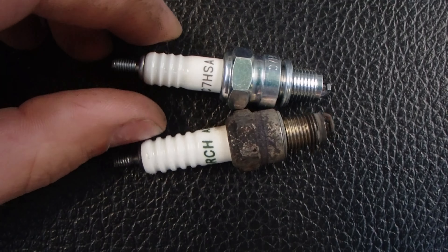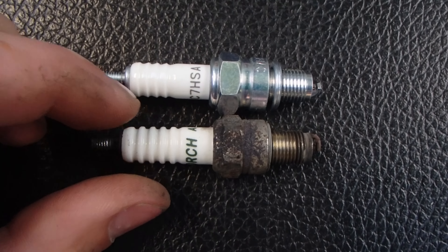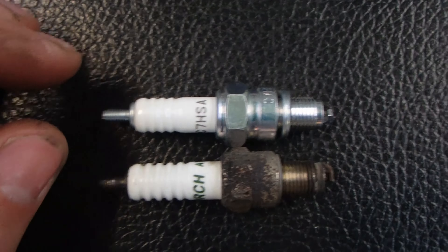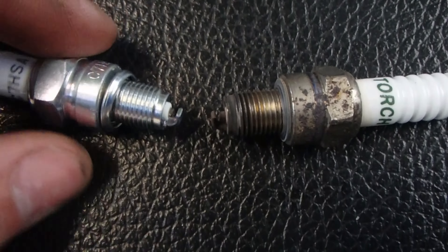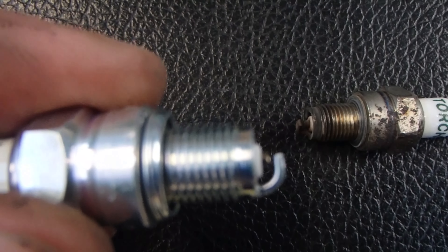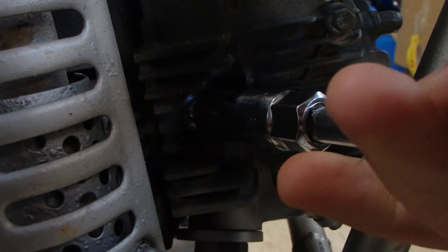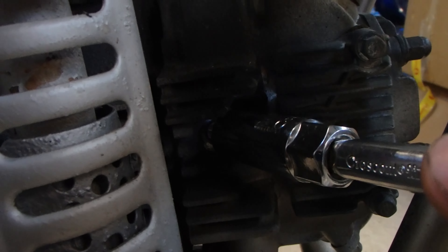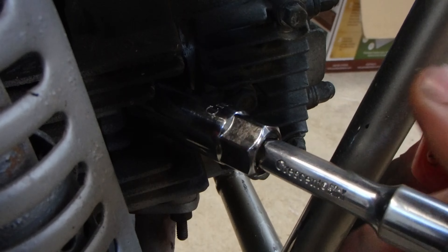Comparing the two, you can see fairly similar dimensions. I don't know that this is an exact replacement but it matches dimensionally being an M10 thread size, so hopefully that'll get us going. This is a different size to what you have on your conventional postie bike — they use a substantially larger spark plug. I put the size for the standard Honda postie in the description, but that's no good for this motor because it's too big. You need an M10 with half inch depth spark plug for this one.